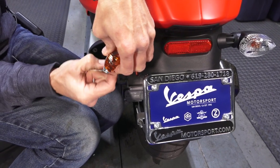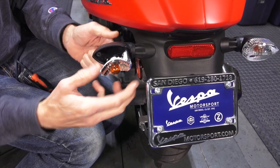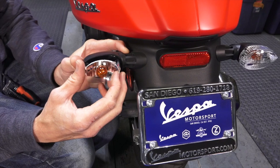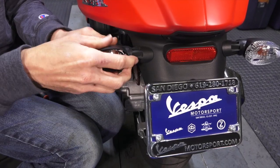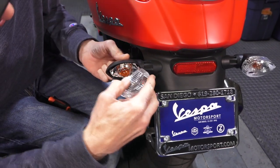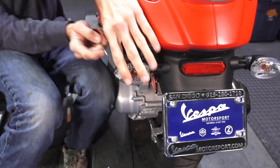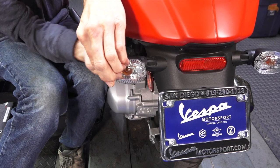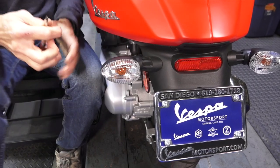Very common — you can call it an issue, but at least the turn signal doesn't break. Make sure both connections are on — the two different size connections. See this fork right here? When you have the plastic pod seated all the way against the rubber stock, the fork engages with the rubber stock. Just push that back in and now it's tight. Pop the lens back on — it kind of tips from the inside. Take your small screw and go from the back side. Don't over-tighten it because it is a plastic screw. Now that's fixed.